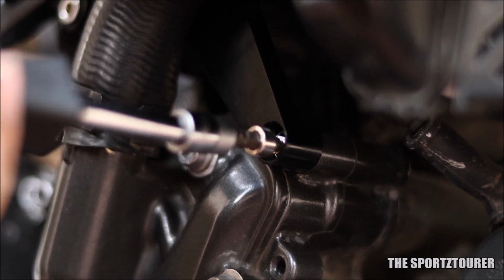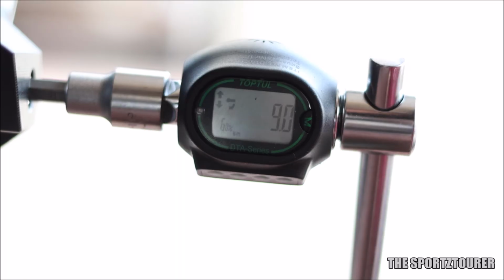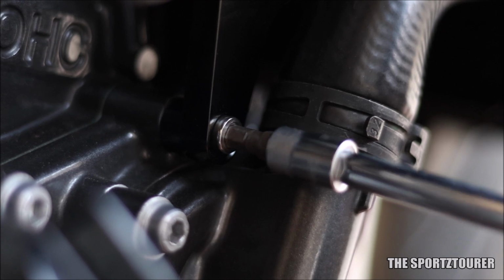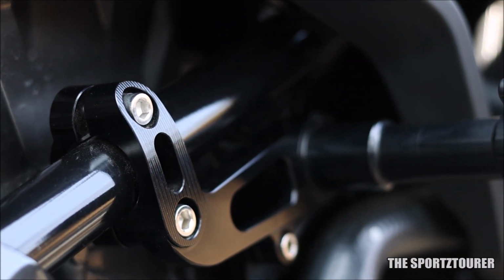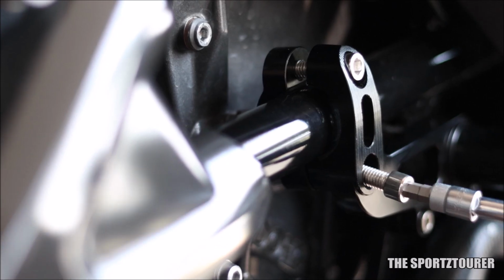If you are wondering about the tightening torque requirements, then most of these 5-6mm casing bolts require torque between 10 to 15 Nm. Now this could have been a matter of concern if the slider was completely dependent on these casing bolts, but thankfully these are just the holding points for the slider, as the actual reinforcement is coming from the chassis tube through this bar clamp, which is secured by a bigger 6mm hex bolt.